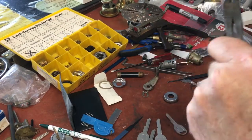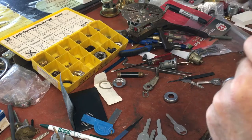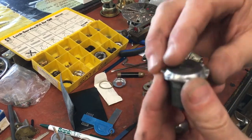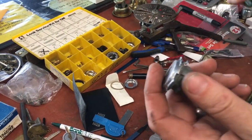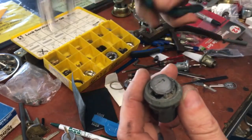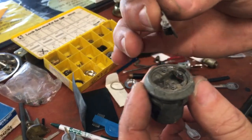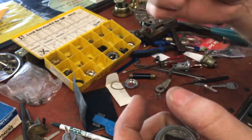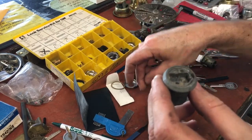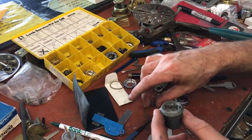Once you verify you have your replacement cap — this one uses the common face plate — go ahead and peel it the rest of the way off. There are tools designed to peel this face cap off so you can reuse it, but I've never purchased one of those. With GM caps it is not overly necessary because they are still commonly available, so this is always just a scrap metal item. Once you get the cap off, we have our face plate, spring-loaded plate, and the two springs. Set them aside because you're going to want to reuse those.